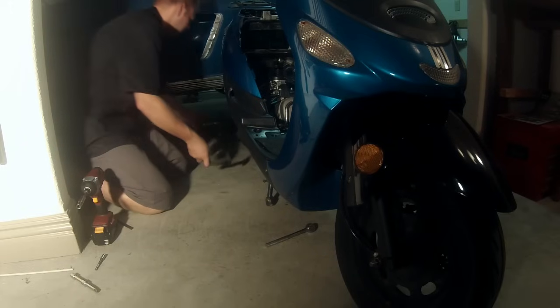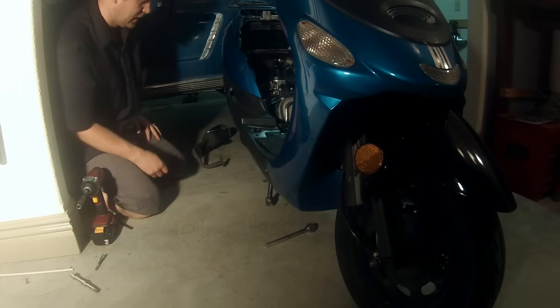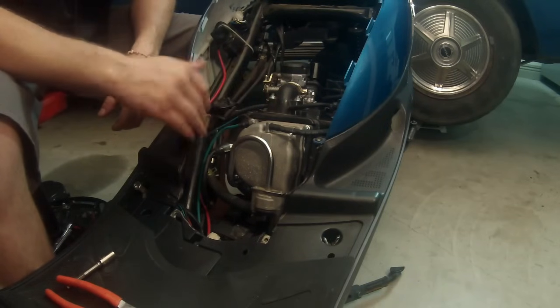There we go. So I'm going to set it off to the side, set it underneath the 64.5 coupe here. All right, now the fun begins. We're going to start tearing into the engine. First thing we're going to do is start removing vacuum lines, remove the spark plug, and get the carburetor out